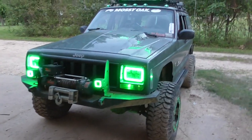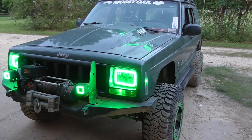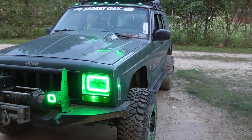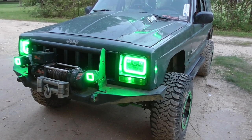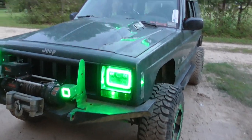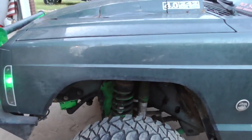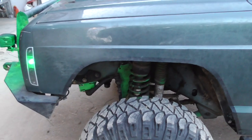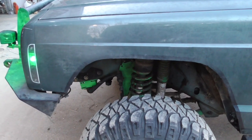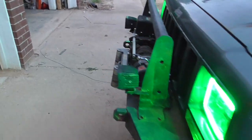Get everything else up, get it back, and see if it fixes it. See if putting my bad tires in the back and doing those ball joints helps. If it did, I'm still going to put those control arms in, because I want to get more caster. I want a little bit more forward caster. We'll see. Anyway, I'll be back.